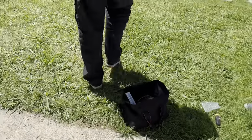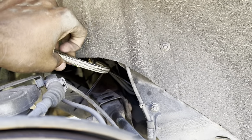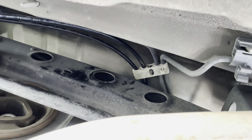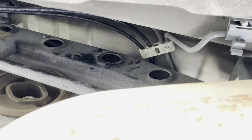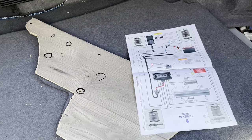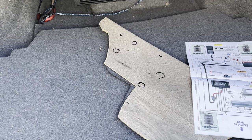All four air lines have officially been ran through the car. On the passenger side I couldn't drill a hole so I ran it along the outside and will zip tie it. Both airlines are ran through the right side. Now for the fun part — we're going to drill holes through the false floor and hard-mount the compressors and tank. We'll probably do the manifold mounting in part three.